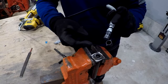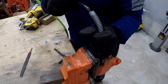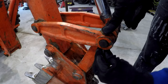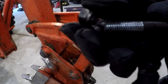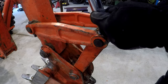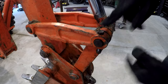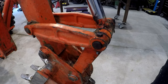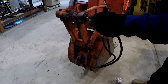This is my grease gun - a Dewalt battery-powered grease gun. Before, this round tip would not have fit down inside of there, but now it fits down in there no problem. So I chased the threads and cleaned them all up. This has a self-locking element inside of it, so I only went in a tiny little bit. Hopefully cleaned them up enough that I can get this thing started and just drive it home. Feeling pretty good about that - nice and cleaned up, hardly any slop. I'm going to go ahead and grease this side and we'll be done with this one.